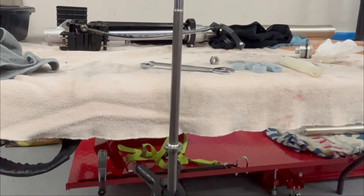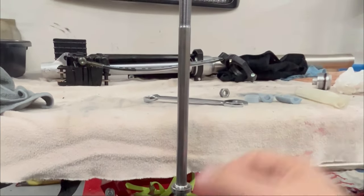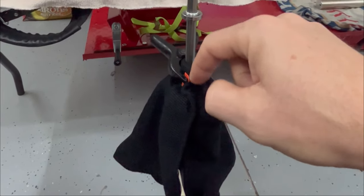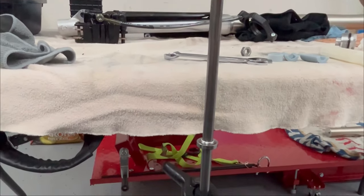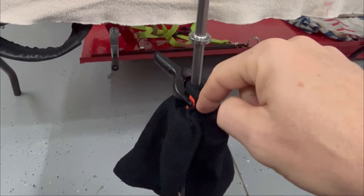Just in case, I wanted to design something that would prevent the tire from coming all the way up and hitting the fender or the frame. These would go in here, putting a spacer between the stop and the washer and rubber bump stop on the other end of the shaft. When the shock is compressed, this rod slides down and bumps into the rubber bump stop that's up against the cartridge.